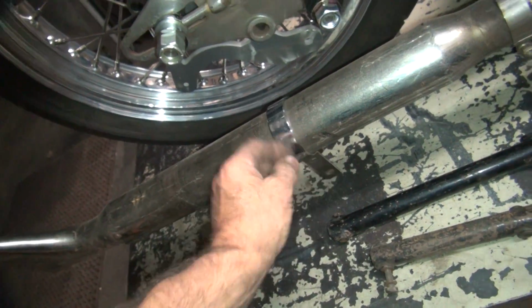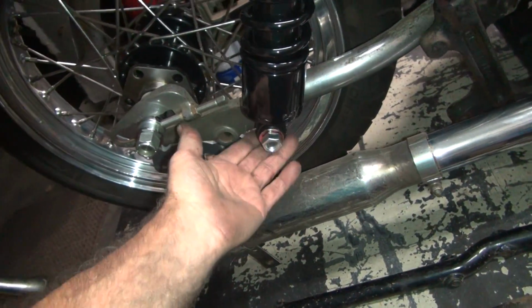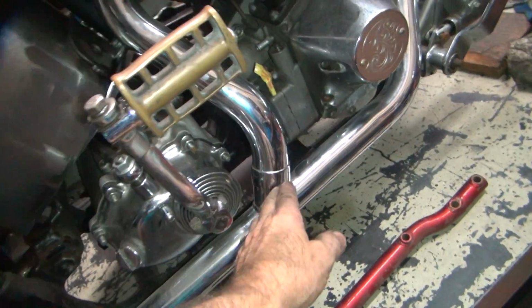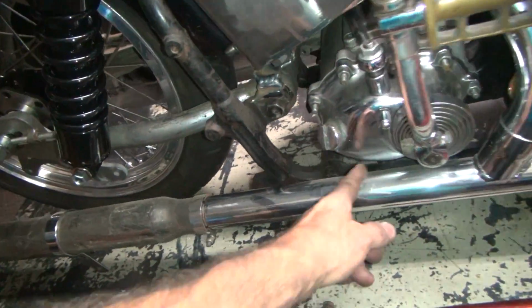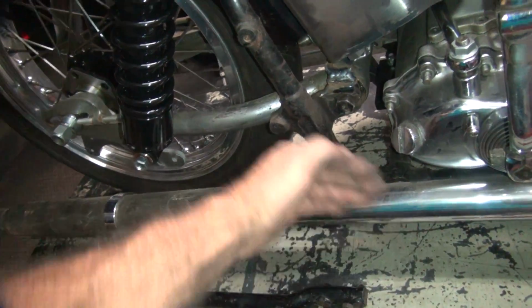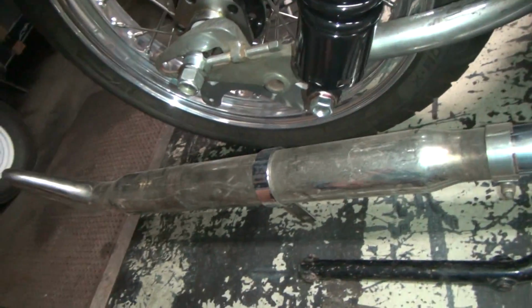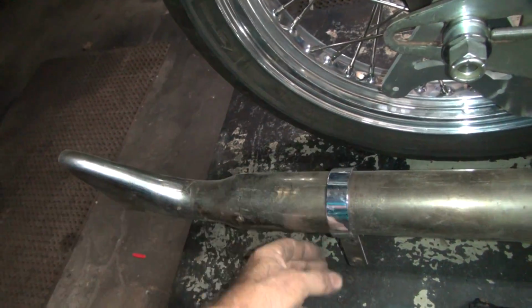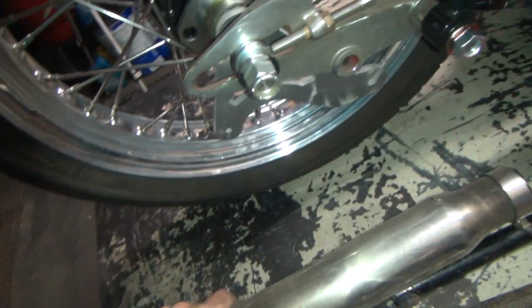So we're gonna hang it down low, I guess. The bike's pretty low, so I don't want to get too low, because we're going to drag. So we got to get tucked in also. It should be up near the shock, but the way the exhaust is coming, it won't be that way unless you do something like I did on my race bike, where I put an S-bend in here and bring the thing in and up. Get that sucker tucked up real nice and tight where it belongs, up high. And way short, it needs to be way over here, not way up there.